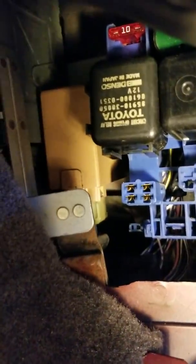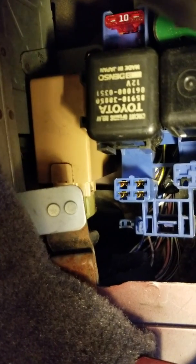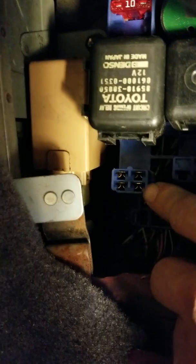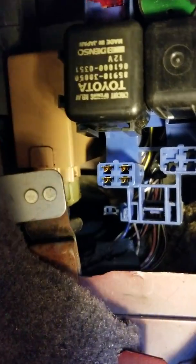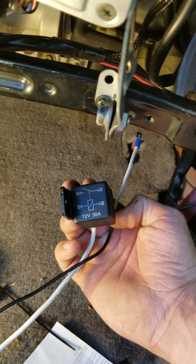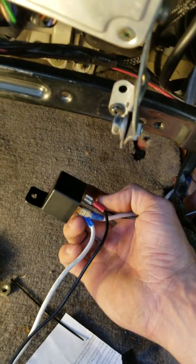There's a series of wires: a black wire, a black wire with a white stripe, a black wire with a yellow stripe, and a blue wire with an orange stripe — this varies on different years. Looking at a schematic, I'm going to hook up to the black and yellow wire, which is the bottom pin, and that wire goes to the ignition. Basically what we're doing is bypassing this relay and swapping it out for a relay from O'Reilly's or AutoZone — just a four-pin 12 volt 30 amp relay, about eight bucks.